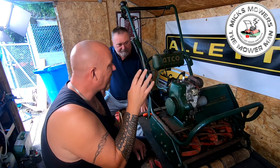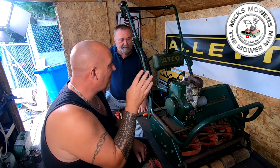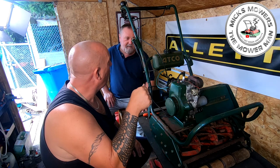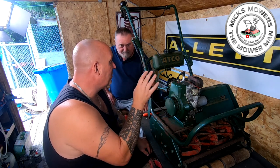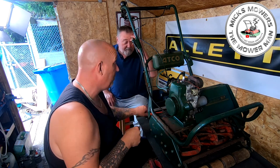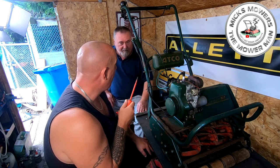Now if a carburetor has been cleaned over the years or the carburetor is dirty, it may be struggling. And the same with a diaphragm machine. If a diaphragm is a little bit stiff and not flexing as it should do, it needs a bit more fuel. So all I've done here is that saying, I'm hunting, I'm surging, I'm not very happy, I'm not getting a significant amount of fuel, I need more fuel. And all I've done, literally, is just gave it more fuel.